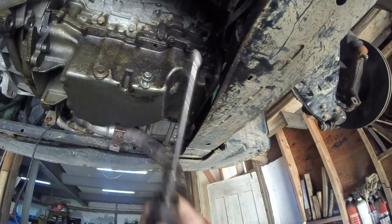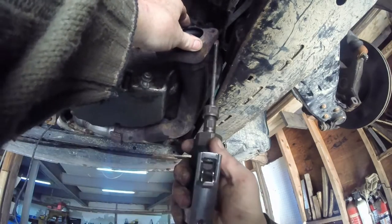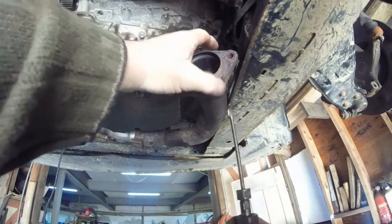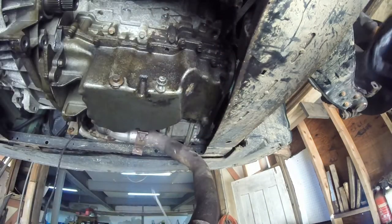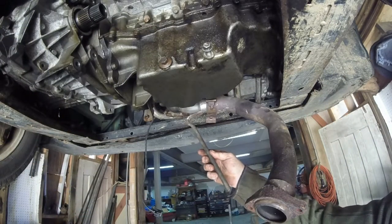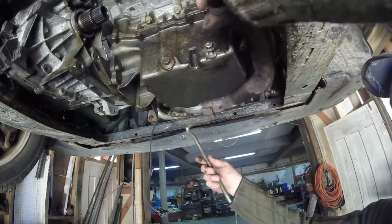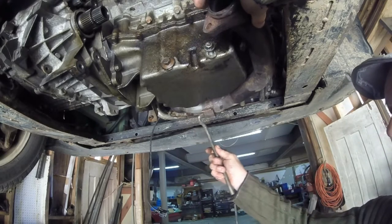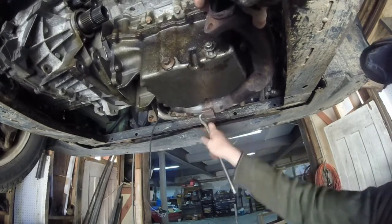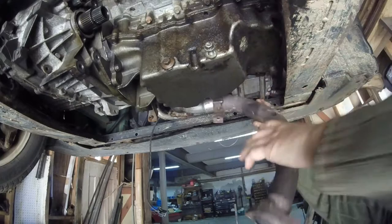On this one I sliced the bolt in half with a chisel and popped it out. On this one I used a die grinder with a really long carbide shank to get up around everything and cut the bolt off, then popped the nut off. To pull out this pipe, I used a Snap-on exhaust expander tool — it's like a duck bill. The pipe was rusted directly on, so I took a hammer and made a wedge to expand the joint, wiggled it, and pulled it out.